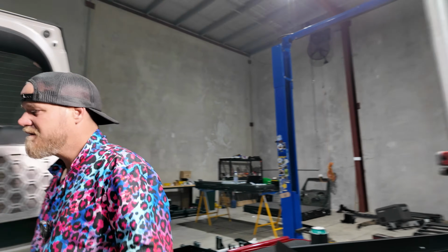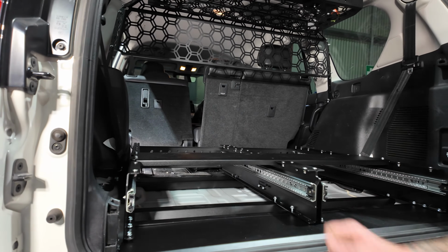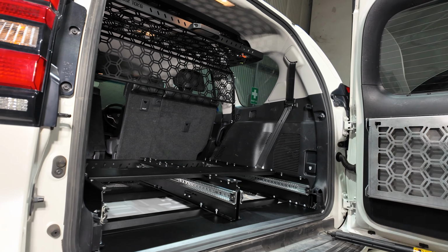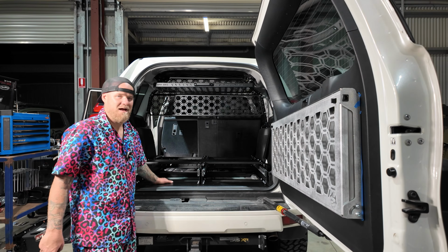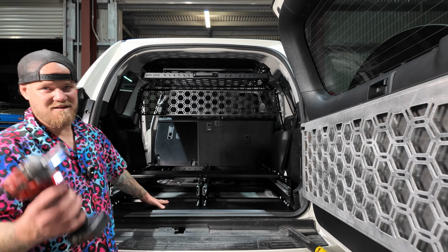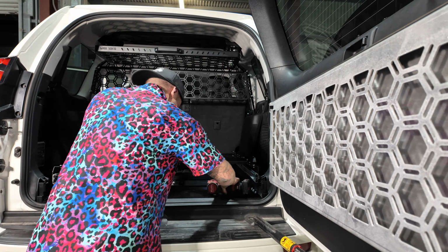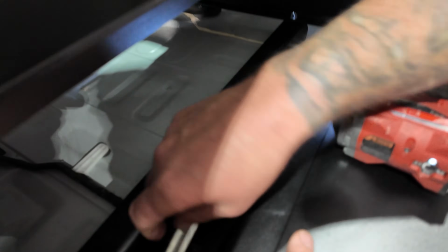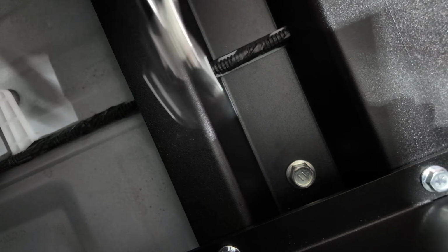Now go through, tighten up all these ones now. Also, before I forgot, we need to put bolts in there too. So when you put this piece in, don't forget to put the middle bolts in. I forgot. So over here now, we're going to do the original bolts that held the seat on. So it's a 14mm. Go through. That one needs a spanner. Then we're going to get the spanner out. I've left the bolt up too high. Oh, yeah. Okay, that's that done.